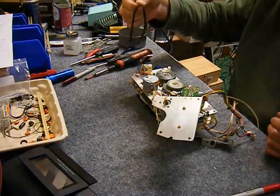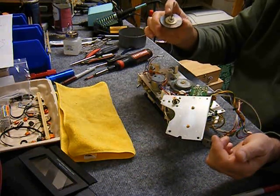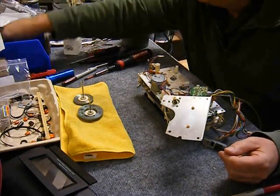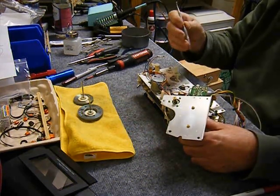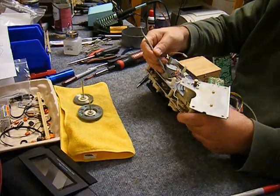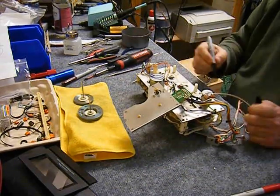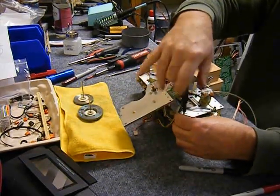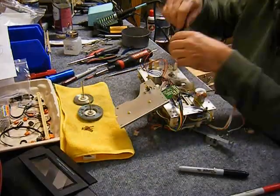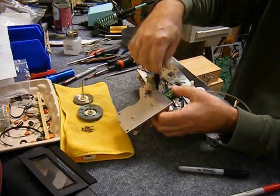Try not to apply a lot of torque when turning screws here. Here are the capstans being removed. Take note of the spring on the capstan — make sure you don't lose the spring. Notice that the capstans are different sizes. There are three springs holding the transport together; I'm removing those now using a little hook from the Harbor Freight store. There are also six screws here that are a shorter length from the previous four, so make sure you don't mix up the screws.